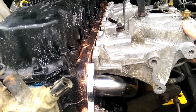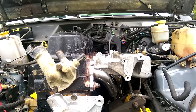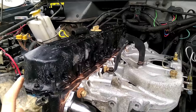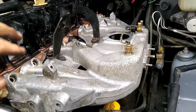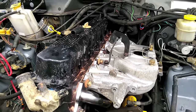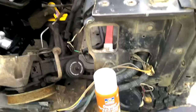Now if you notice, not only does it sit flat, it actually sits down a little bit, so now you know we've got plenty of room. Now you can see that it's sitting perpendicular. With the Renix head, all the exhaust bolting surfaces were studs. On this one the top one does not exist, so you'll have to make sure that you grab at least one bolt from your junkyard head. You'll need one more bolt than what you did previously, and you'll have a nut left over.